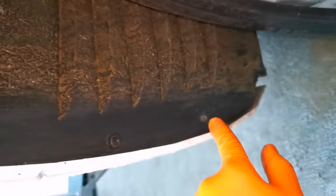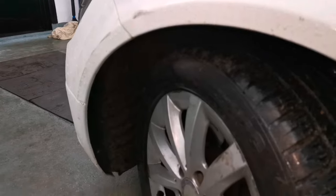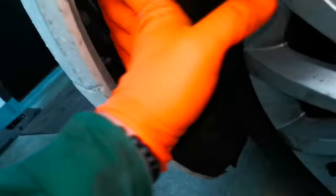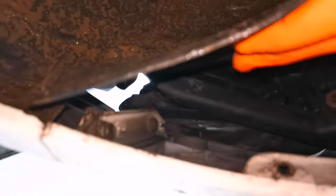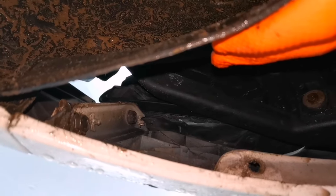After that you will need to remove the protective dust cover from the wheel. You will have a few plastic clips — you can try to remove those with a flat screwdriver. I just removed the clips, and after that you have to pry open the plastic cover. Inside, next to the headlight, you will find two 10-millimeter bolts which are holding the bumper, and you have to remove those bolts in order to release the bumper. Do this on this side and also on the other side.